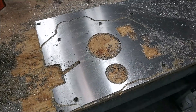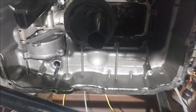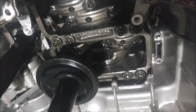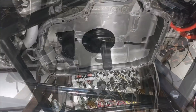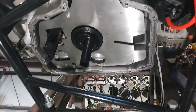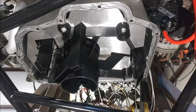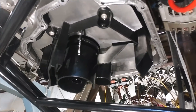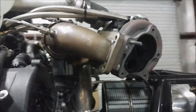There was a bit of back and forth just to make it fit just right, and I was modifying the CAD as I went along, so we have a good CAD template now. Looking up in there you can see the crankshaft and the bottom of the connecting rods — you don't want oil splashing up in there in big amounts, which could happen if you hit turbulence or negative G's. So that's what it looks like with the windage tray — it allows oil to drip down around the sides and through little gaps but won't allow a big amount of oil to fly up into the crankcase area. That's it with the little lower bracket from the engine fitted into place, and the sump tray goes over that. We'll be putting a weld bung into the sump tray so we can return the oil from the governor.